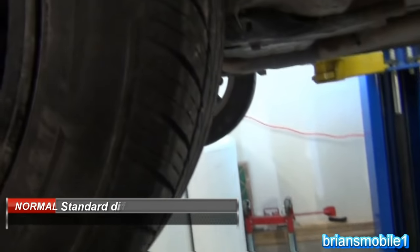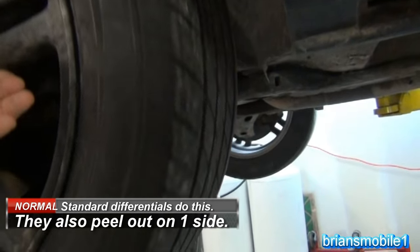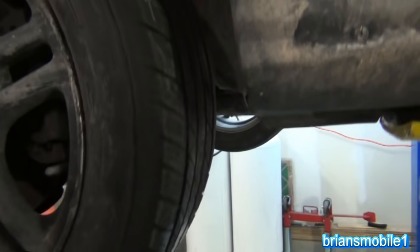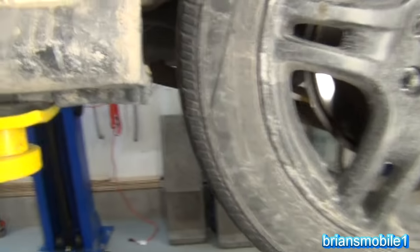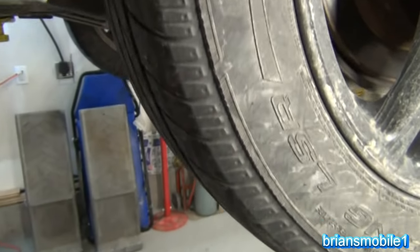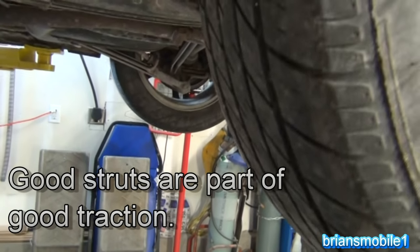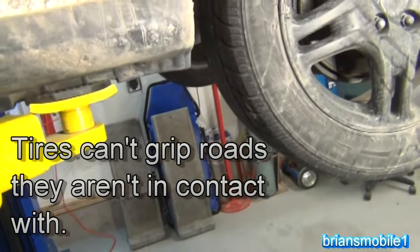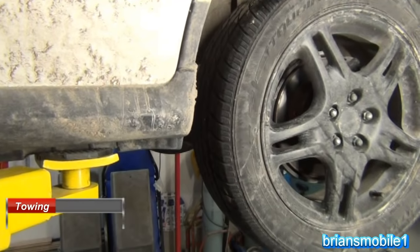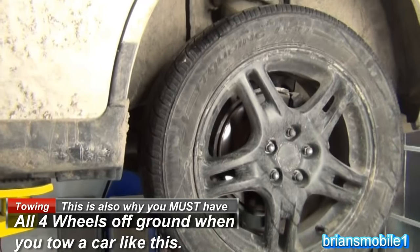Most vehicles are like this front differential here — watch one tire, it'll spin one direction and the other one will go the opposite way, and that's normal. That's what you get, and in most four-wheel drive vehicles you'll get that alternation between the whole rest of the vehicle. But on the back end of these Subarus, when I turn the back wheel, I turn the back one this way and the other one goes the same way. So even if one wheel's peeling out you still get a little hookup in symmetry. It's like having a locker in the rear end but it helps you go around corners fine.